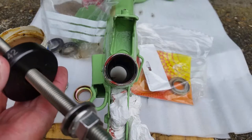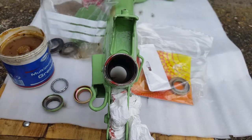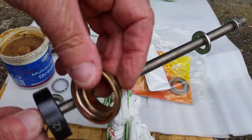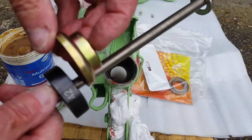This is a 42mm bearing press piece and the other one is a 50mm. The idea is they just have to fit exactly — not too small and not too large — so that the bearing is pressed in evenly.